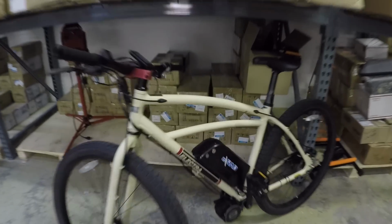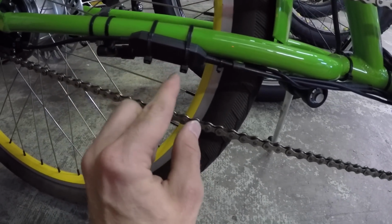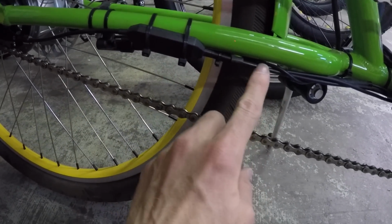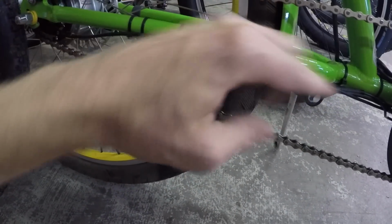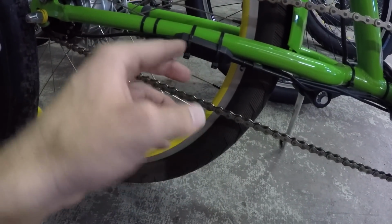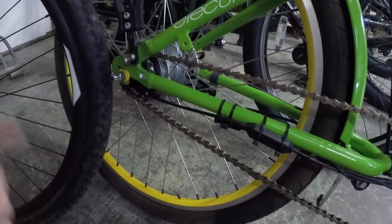It's actually very cool. Before I get to the full review, I'll try to show it somewhere on the bike here. Maybe there's one that's hanging. There it is. There's a real clear shot of it. See that? Inside there's a wheel thing, and the wire, they custom cut the sheathing. They start out with a wire, run it through there, and it runs over the little cog. So whenever you're shifting gears, it's sensing that, and it tells the motor to stop pulling.